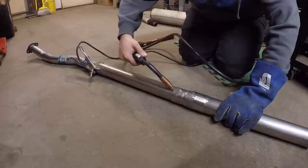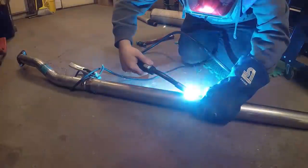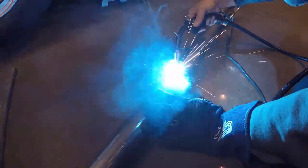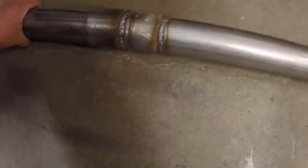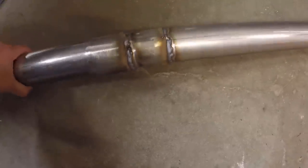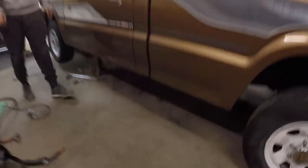For now we're just going to put this together, bolt it up, and see what it sounds like straight piped. We got those welds done and they look a lot better compared to that first one - this is what it looks like when it's flat and tight around it, so that looks pretty good. We can go ahead mount this on the car and see what it sounds like as straight pipe. We just managed to get that whole pipe we created bolted up - it's completed, technically straight pipe - comes to about the end of the cab.